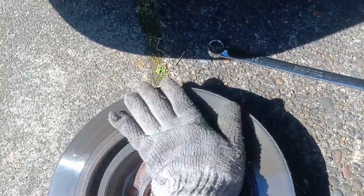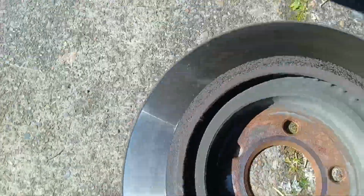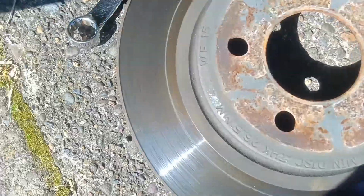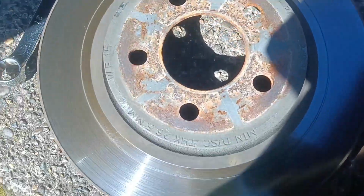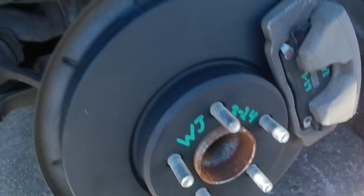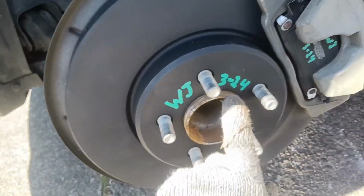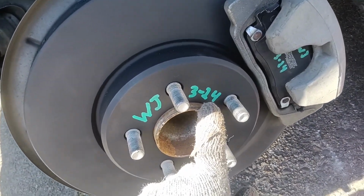They said there was some shake on this car. There's definitely glassiness to this rotor. It's definitely had life. Some of the polish spots may have gone away with the new pads riding on there for a minute. But in any event, crusty, old, not so bad, bad enough, warped enough to cause customer issue. I don't think this is my main culprit though. That being said, look at that beautiful stuff. I mean, we got it marked Willie Jenkins, March of 24. Can't get no prettier than that.